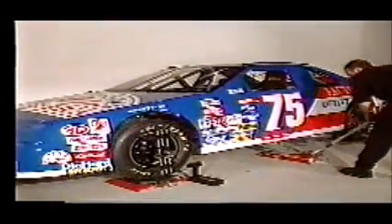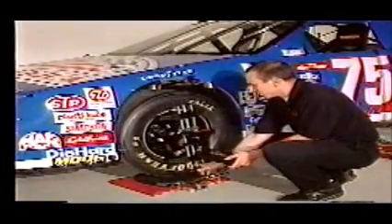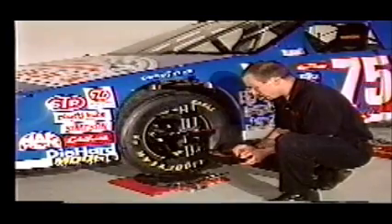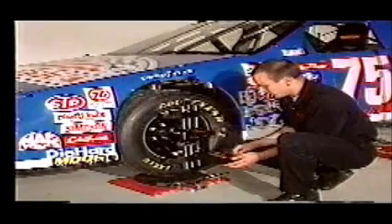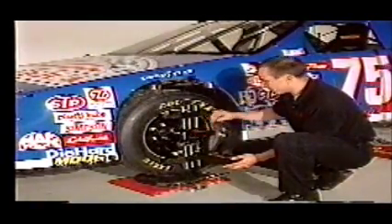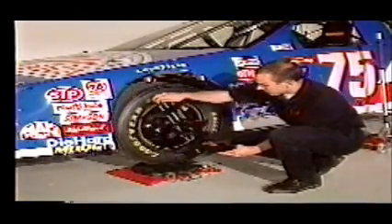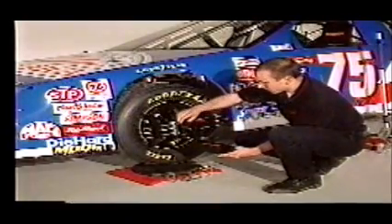The car must be in the air so the wheels can spin freely. Using the Easy Check Angle gauge, the technician hangs the gauge on the precision disc. With the gauge in place, start with the car in the air and the wheel in the six o'clock position with the clamping knob as the reference point. The technician zeroes the caster scale and rotates the wheel until it is in the 12 o'clock position, gently keeping the Easy Check from rotating. The technician takes a reading of the caster scale and adjusts the knob closest to the clamping knob until the caster bubble moves halfway back to zero. Then the technician rotates the wheel to the 9 o'clock position and zeroes the caster scale, rotates the wheel to the 3 o'clock position, and takes a reading. Adjust the two vertical knobs on the wheel clamp until the caster bubble moves halfway back to zero, so that when the wheel is turned the caster bubble does not move on the caster scale.